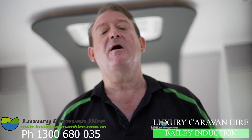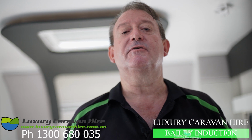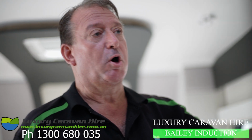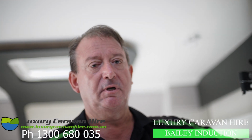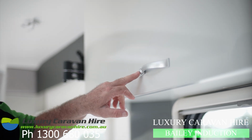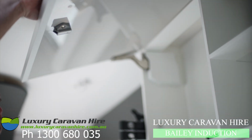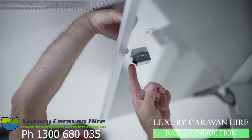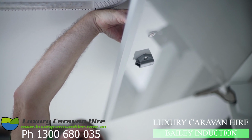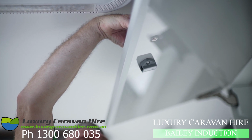Okay folks, let's look at how in the Baileys you operate the door handles. So clearly for travel the door handles will need to be locked, and they're nice and secure. In this model, with the external handle, to unlock the door or drawer, because they're all the same, we're going to push that central button while we pull on the handle. And as you can see up here, as I push the button in, the catch operates. So we've got locked, unlocked, locked, unlocked.